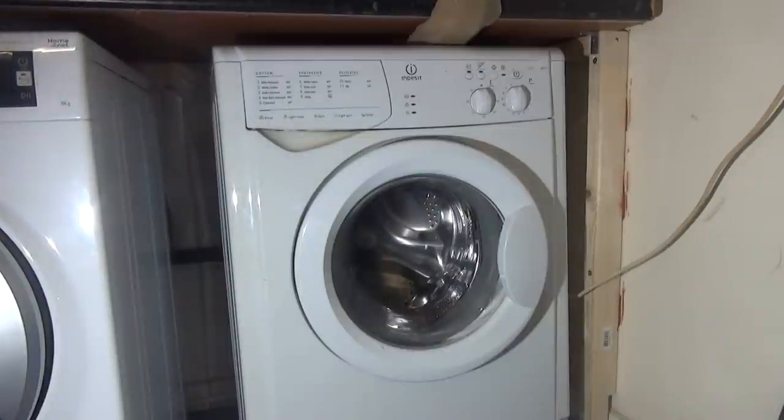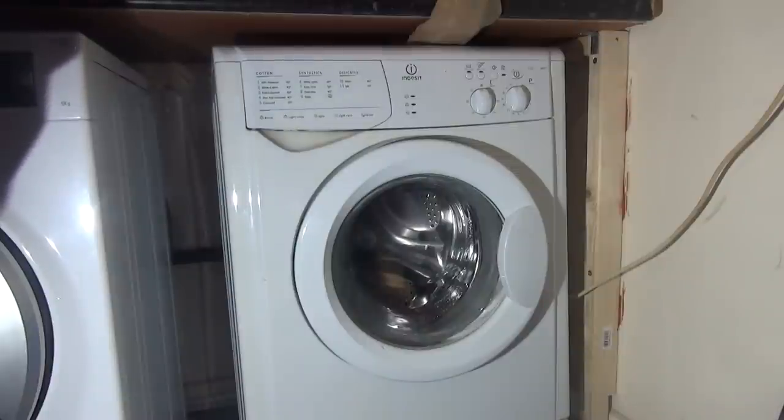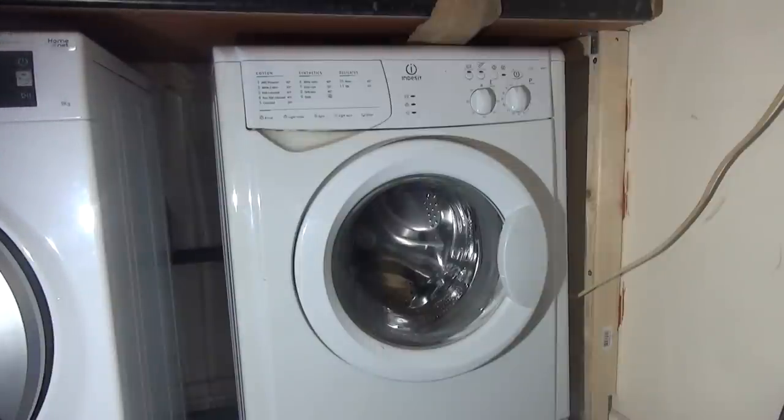What it's actually involved doing is taking, obviously, the top board, the back board, rewiring it, and changing the pressure switch and the mains filter as well. Because the WIB and everything onwards from that use a different pressure switch plug and a different mains filter in. So, a different setup as well.